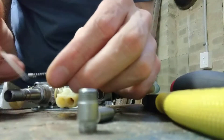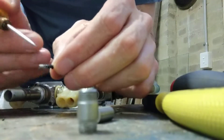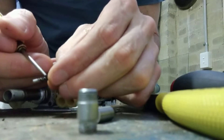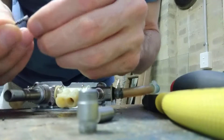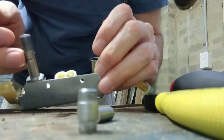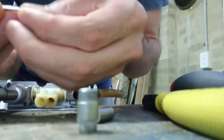So the problem I've got on this coffee machine is I'm not getting pressure on a Breville BES 860, which is very similar to the BES 860 XL. I'm certainly not a coffee mechanic — I'm just a bloke trying to fix his coffee machine for fun. Hopefully this has done it, because I've pulled apart the three-way solenoid and cleaned the hell out of that. I didn't find that to be nearly as dirty. That's the larger three-way solenoid there, and in fact you can take this whole assembly apart.